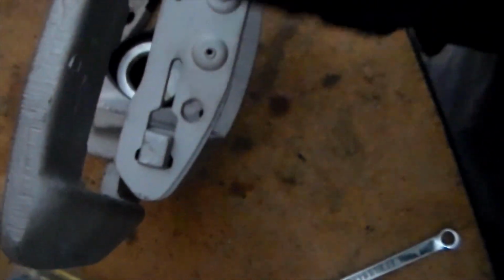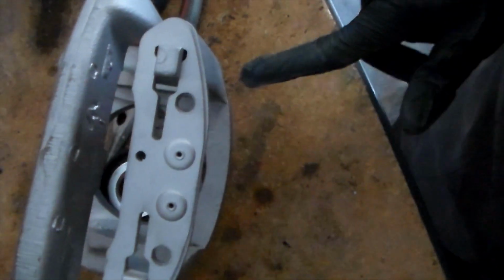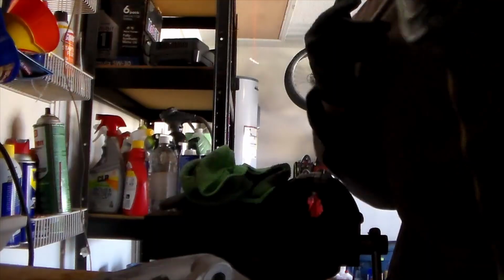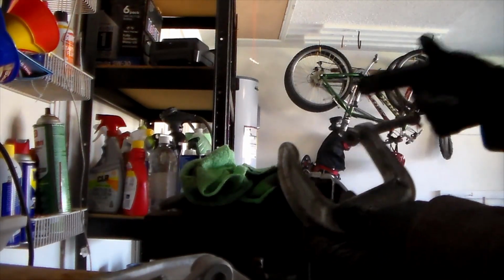And so what you want to do here is you kind of want to line them up with, shoot, there we go. So what you want to do here is you want to line these parts up with the grooves in here, and then you want to push it this way so then it kind of goes out of the way while pushing this way as well, so then you can get this over, and then you can do the same on this side, and then it'll slip down onto the piston. The most challenging part of this is probably getting it in there and getting it to stay.